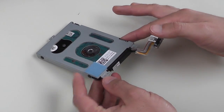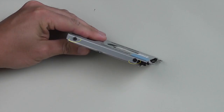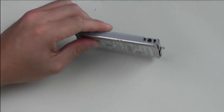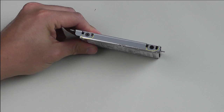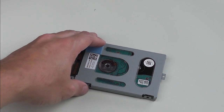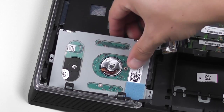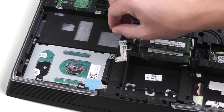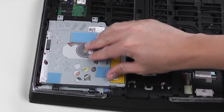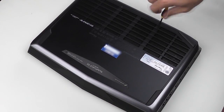To replace or install a new hard drive, disconnect the hard drive cable from the old drive and connect it to the new one, then place the hard drive back into the system. Reinstall the optical drive. Reinstall the battery, the bottom door and its screws, and you are done.